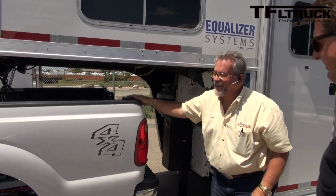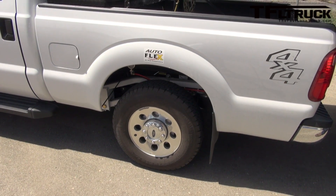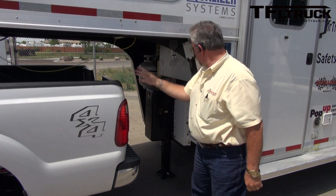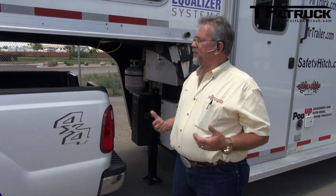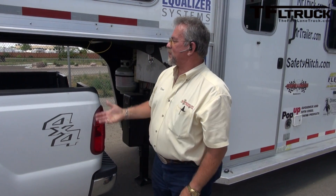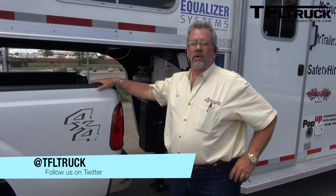Let me find the lever — pull it forward. There we go. See that? That's how much it dropped. So to visualize it — I have it up — let me lift the trailer up a little bit. There we go. Now you back up under your trailer; your truck has dropped five inches, you back up underneath it, get it under the ball, and then just trip that lever again. And you lift the truck back up — there it goes, it connects to your trailer. Especially if you've got a hand crank on your trailer — think about jacking it all that time. If you can take five inches out of that equation, that may be half the stroke of your jack. A great feature: let the truck do the work.